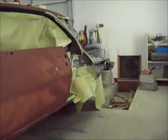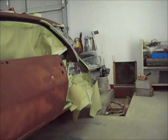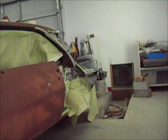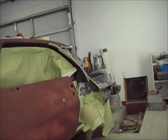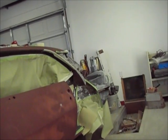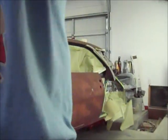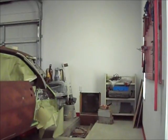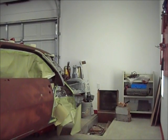It's not professional but it'll work. There's a paint filter in the wall to filter out some of the paint. Got it all cleaned up, went over with a wire wheel again to remove any surface rust. Used wax and grease remover. SPI says for their epoxy you have to have the metal temperature at 65 degrees before you spray. Right now it's only 65 in the shop, supposed to get up to 70.